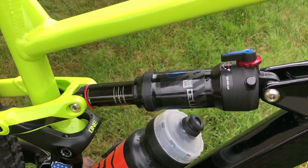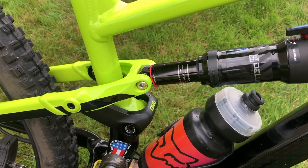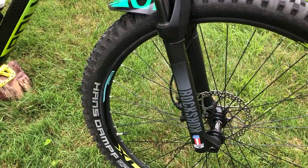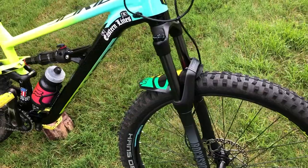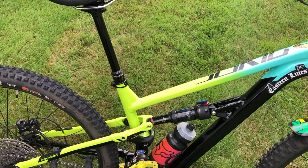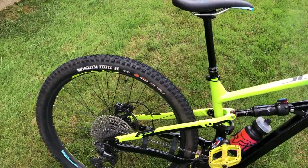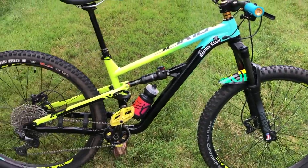Okay, so the rear suspension is the RockShox Deluxe Select Plus, 130 travel. I'm 5'10", 200 pounds. I have the sag set perfectly at 30%. I got about 180 pounds of pressure in it. My Recon 140 mil travel fork I have set at, I believe, 130 pounds of pressure. I usually keep the rebound pretty high unless I'm hitting some jumps, and then I'll turn that down. Sometimes I could lock out the shock if I'm hitting some crazy uphill stuff to stiffen the back up. I believe I got about 24 pressure in the back, 19 in the front on my tire pressure.